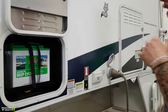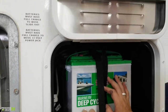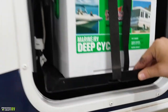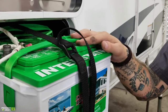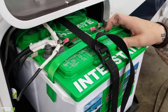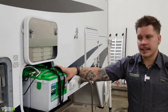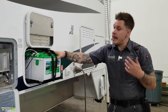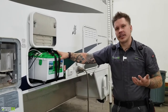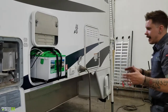We have your battery drawer here. Your battery bank is made up of two Group 24 deep cycle batteries with a slide-out tray. These are lead-acid batteries, which means they are going to carry some maintenance periodically — generally two or three times a year. We're going to pull these vent panels up, check the water level, and refill with distilled water as necessary. There is also a battery disconnect built into the unit. That battery disconnect is very important to utilize for periods of long-term storage. It will isolate these batteries from the 12-volt system, keeping any nominal or phantom draws off of the system, which will further extend the life of the battery.